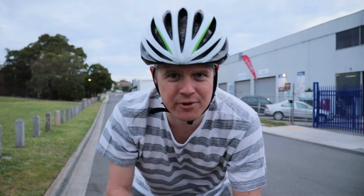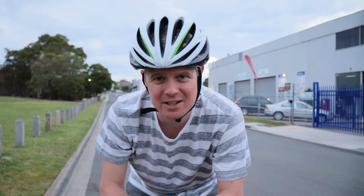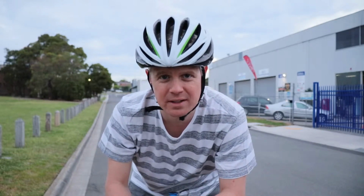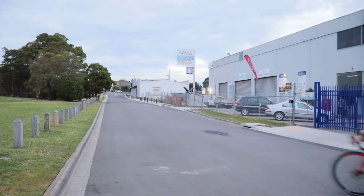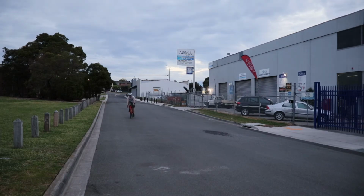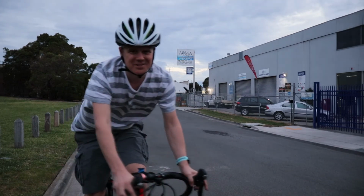Well, I've been riding around for a few minutes now. The boot is still in place. So that's at 40 PSI. I took a measurement just before I headed out. So I reckon if you're gentle with your riding, you take it very steady, you could get home on this. So I'm gonna say the $5 boot worked a treat. Thanks a lot, bye-bye. Still hasn't blown.